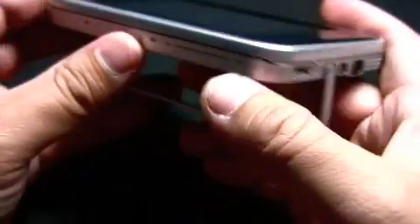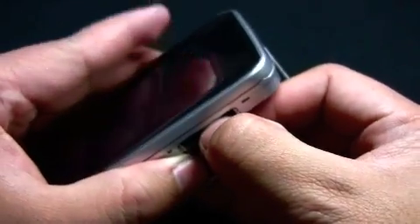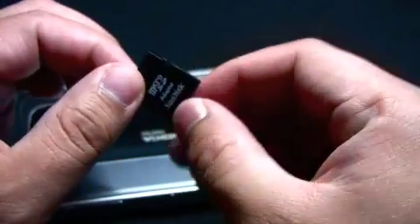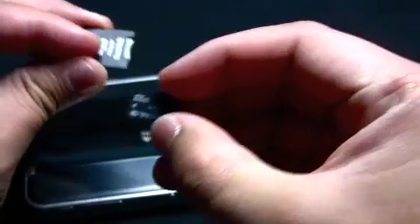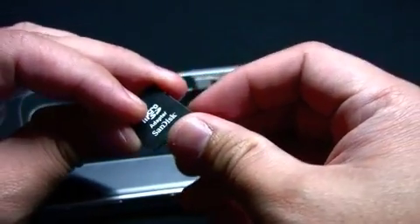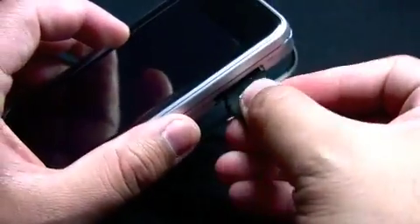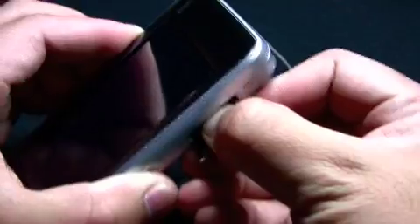Towards the bottom of the N810, you'll see the new mini SD port. Mini SD is about half the size of a regular MMC or SD card. I'm inserting my mini SD card — I'm actually using a micro SD adapter to convert it to mini SD, so I can reuse my Nokia N95 micro SD card on my N810. When inserting your mini SD, make sure you push it really hard until you hear the click. Same with ejecting it.